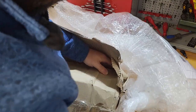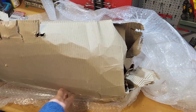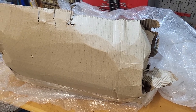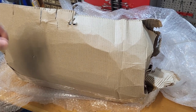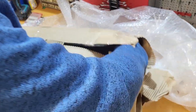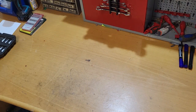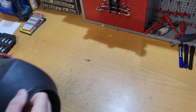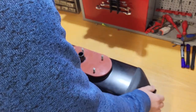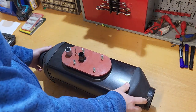I think we never had this heater on the channel. I have one gasoline heater and it has a really interesting failure — it was burning the glow plugs. You put in a new glow plug and it burns it. Whatever I did, I didn't manage to find the cause and we sent it back to Germany. For that heater I have no idea what's in the future, but let's see what's with this one.